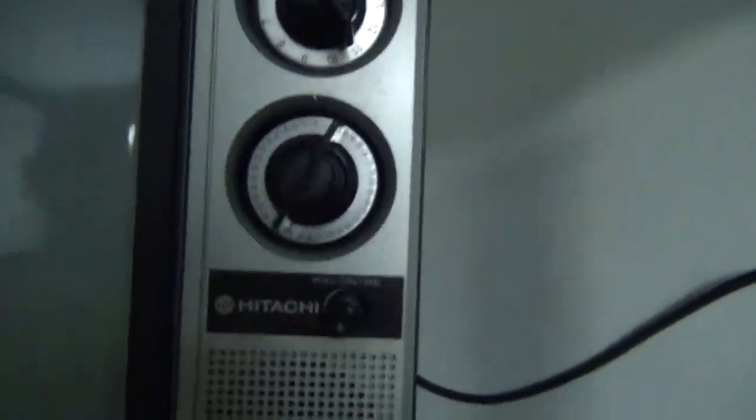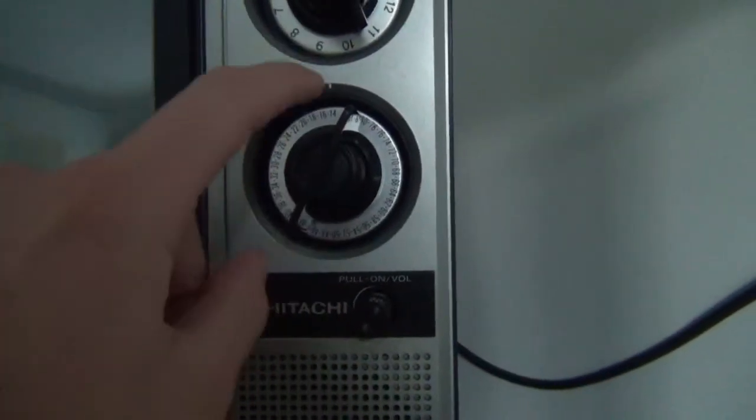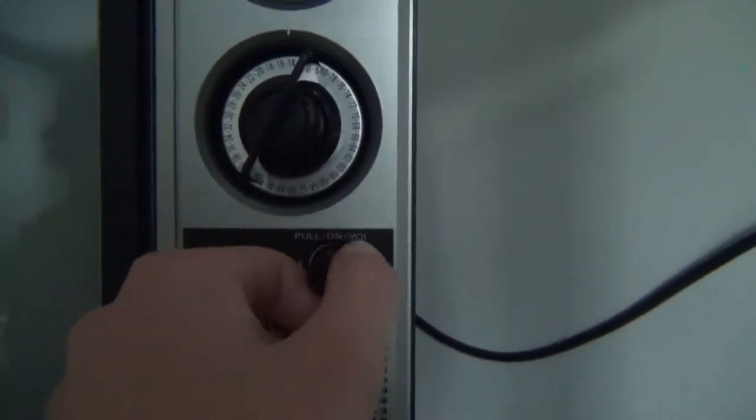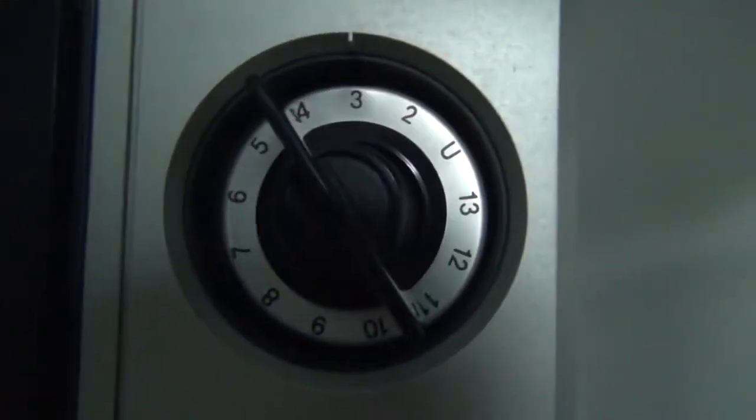I've completely cleaned the cabinet and the inside. You can see it's looking all nice now. The top especially is really shiny and looks flawless. I've cleaned the back too — there's no more dirt in the vents back there. I went inside and applied WD-40 to the tuner knobs because they were a little dirty, and also to the volume control, because it was dirty and would be scratchy. So now it's all clean and shiny.